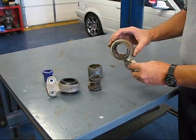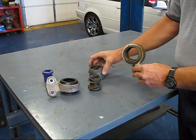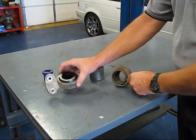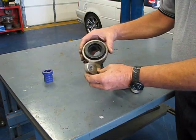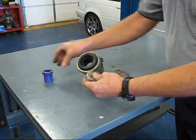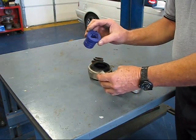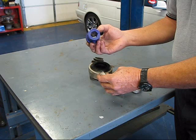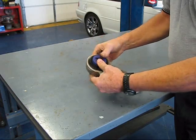Here we are at the table. Here's the bushing that we've removed and what it looks like outside of the bracket. Here's the inner component — that naturally fit inside there at some point. And here we have the other side of the bracket already with the new urethane bushing pressed in. The way the urethane bushings work is they have an outer housing that presses into the bracket, and then there's an inner pivot sleeve that goes inside. The pivot sleeve presses eventually onto the control arm.